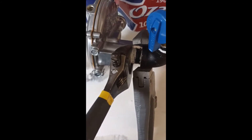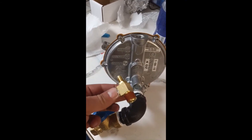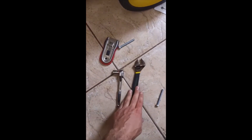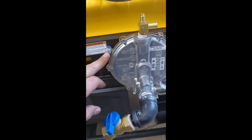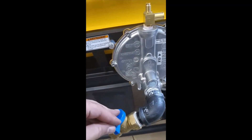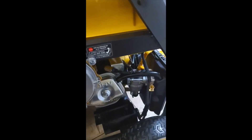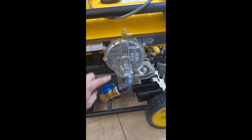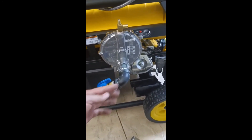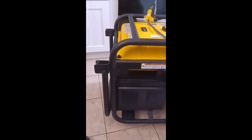This is done. Next I'm going to put this on and then we're going to clean up the sealant mess. I used a 7/16 ratchet and a crescent wrench and tightened these two bolts. If you over-tighten it's going to put a groove right here, so you don't have to go very tight. The reason I went this way - you could have done it differently - but the reason I'm going down is because of the exhaust right there.